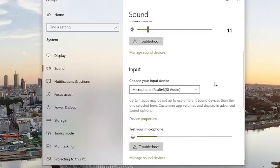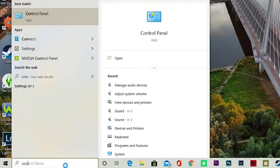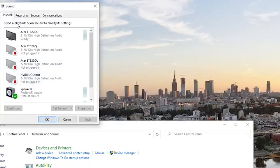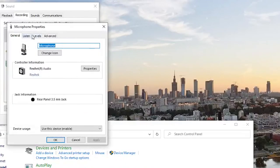If you have other microphones connected to your computer, you can always select the input that you would like to use. Now, in a case where you're using it and you're not able to monitor any sound being registered by the computer, then what you can do is go to the Control Panel, and then underneath Hardware and Sound, and then underneath Sound, click on Manage Audio Devices. Once in audio devices, click on Recording. Right here you can also see that the computer is already picking up sound. But if you wanted to increase the gain because you feel the microphone isn't loud enough, you can select the microphone and go to Properties, then go to Levels.